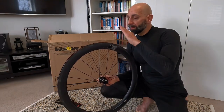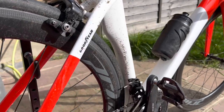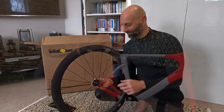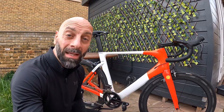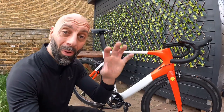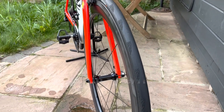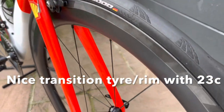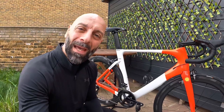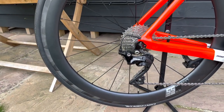I'm going to move the tires onto these wheels and clean the bike — it hasn't stopped raining here the whole month of March, extremely frustrating. The cassette came out nicely from the Prime and went onto the Vision; I got all the rings and spacers in the right place, and swapped the GP 5000 23c tires from one set to the other — always fun, my thumbs hurt and every muscle aches, almost like a gym session.